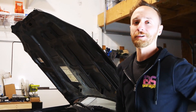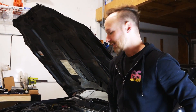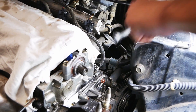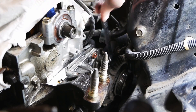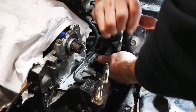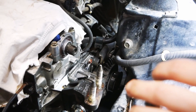With both of those seals replaced, we're ready to get at the water pump. We're going to remove the water pump and it's going to make a big mess and get coolant everywhere. First step, undo the bracket on the alternator, let that swing out of the way, then hit the bolts on the water pump and pull it out. Someone cut themselves — a deep gash on a sharp bolt edge. Someone notes they're surprised it was so sharp, and we take care to avoid it going forward.